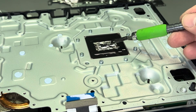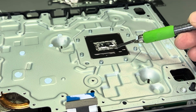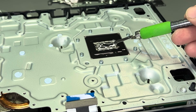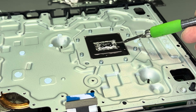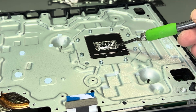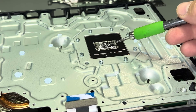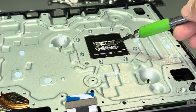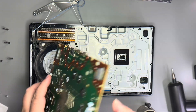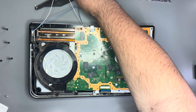One thing I like to do is spread out the liquid metal to all edges. It tends to sag to one side or the other depending on how the console is oriented while in use — eventually it all goes to one side and leaves an area where heat dissipation isn't the same. It's relatively straightforward to move it unless you've got some really dry spots, and then you take the time to clean it. I could make a whole video on spreading the liquid metal. Now we'll flip it back over, gently push it down, and go ahead and reassemble everything.